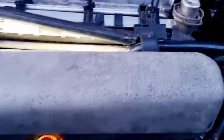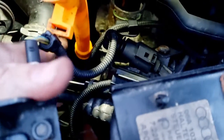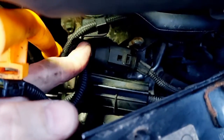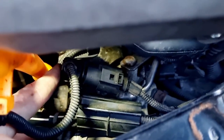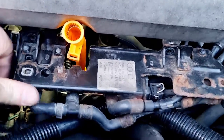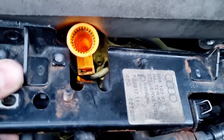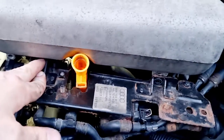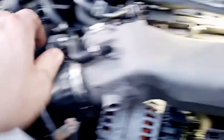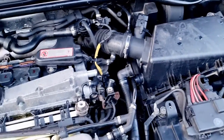A couple of tips as I'm putting this back together. Obviously you take the oil dipstick housing off — you reconnect that — and the bracket that holds this electrical piece to the engine block you just put back together. I unclipped this one so that's now clipped back together and slotted back into its holding position. This bracket slots into the hole of the oil dipstick there, so that will clip back in, then it's two bolts — one this side, one that side. Then this pipe that we disconnected reconnects there, and then we'll move on and reconnect these bits here.